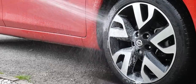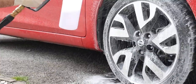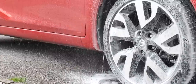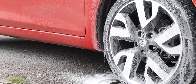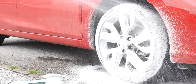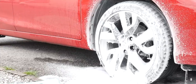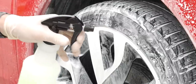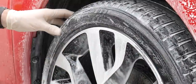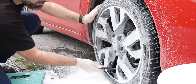On to my first detail in a few weeks and first time giving my car a wash in about a month. Always starting off with the wheels - giving them a rinse down first. I'm trying something a little bit different, applying a wheel cleaner through a snow foam lance. I'm using Detailed Online's Hyper Gel, and at this stage it's mixed at 10 to 1 - and as you can see it's not all that great, it doesn't stick around. So we come back and try it again at a four to one mix - 400ml of water to 100ml of product - and we got a much thicker wheel cleaning solution applied.